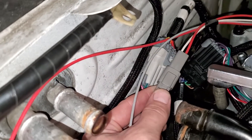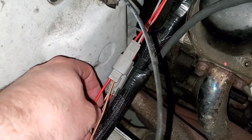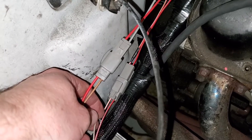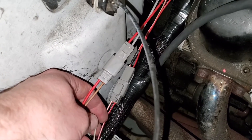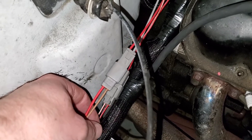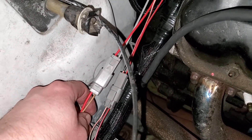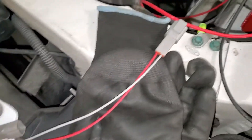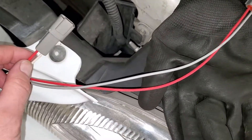This one turned out really good so far, so let's keep that momentum going. Got all connectors in — the tan one is the tach, the red one is switched 12 volt power to the MSD Digital Six AL, white with a red tracer is oil pressure, white with a white tracer is coolant temp sensor, both for the cluster. Those are the last two I added. All three Deutsch connectors are in and serviceable now — there's the tach wire connector, switched 12 volt, and then the points.